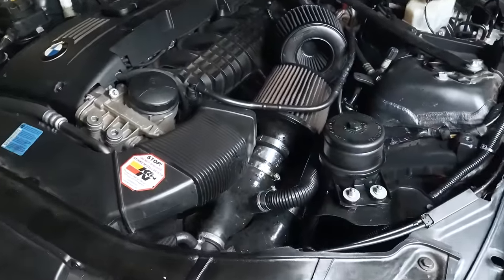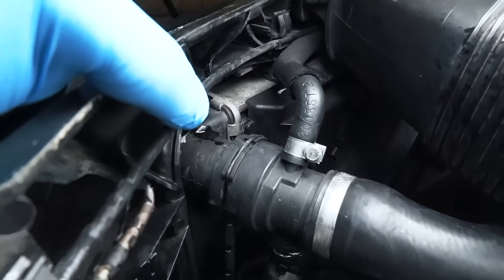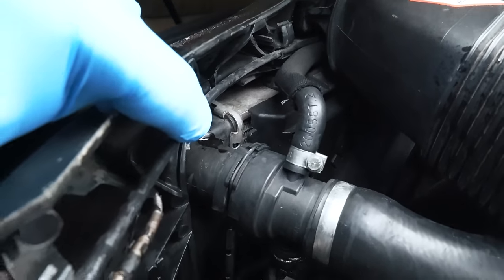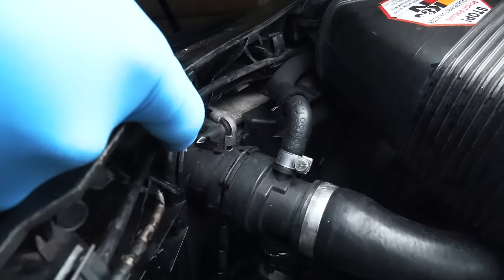So here's a failure point on my radiator. As you can see, there's coolant everywhere. Right here where the radiator hose clicks into place, you can see that it's leaking. With heat, it expands and gets even worse. So it's basically the plastic that cracked over time.